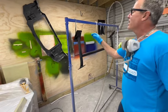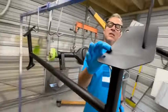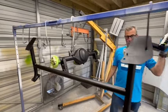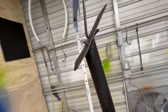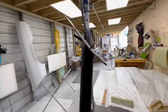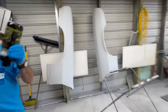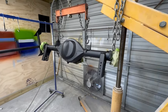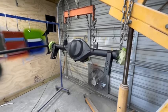Denny is pointing out that he's welded pins on the inside of the roll cage — location pins. He's done that on everything, either pins or holes where you can put a thin screwdriver through. He's aligned all the panels like that; they've either got pins or holes to do perfect alignment first time. Pretty impressive — everything is just so neatly done.